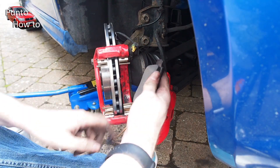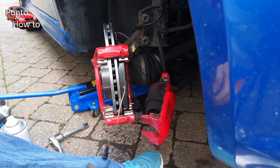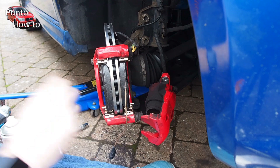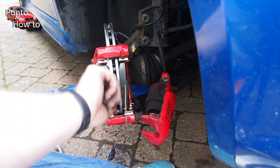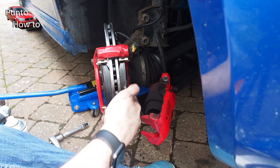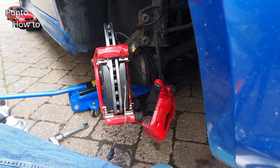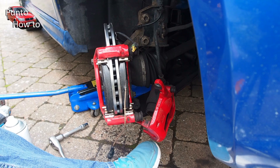On the driver's side we pop the pads in as well, but you'll notice this inside pad has a wire coming off it — this is the brake pad wear sensor. There's a little metal conductor embedded in the brake pad material and as the pads wear down it eventually makes contact with the disc, creates an earthed circuit, and turns on a warning light on the dashboard. As we saw earlier, the wire had been chewed through by the edge of the brake disc. With new discs and new pads this stands much more chance of working, as there won't be such a lip on the edge of the new discs when these pads eventually wear out. It was the rusty lip on the old discs that had cut through the wire.